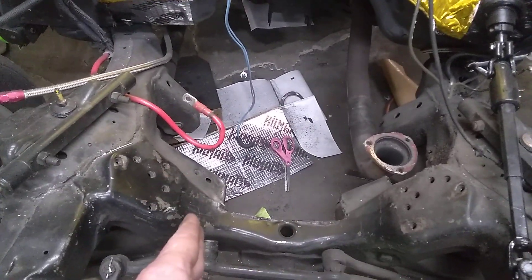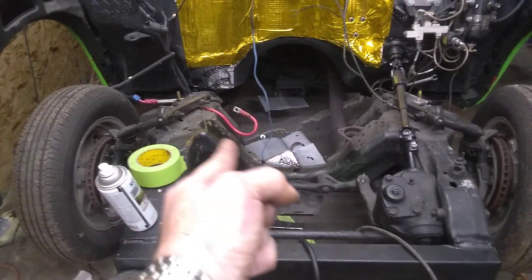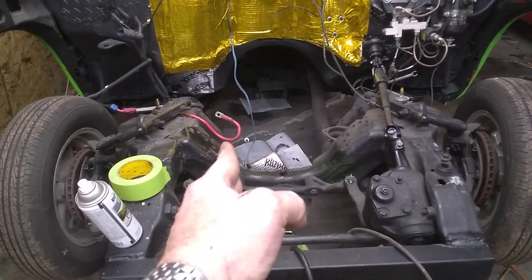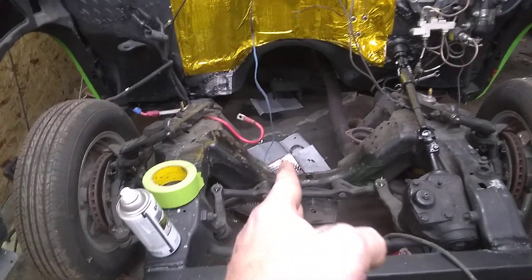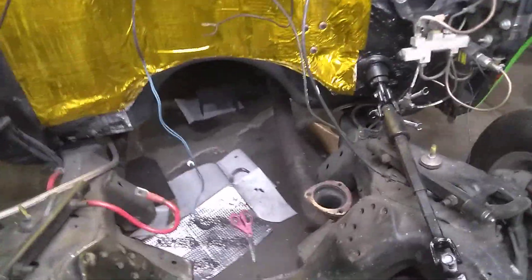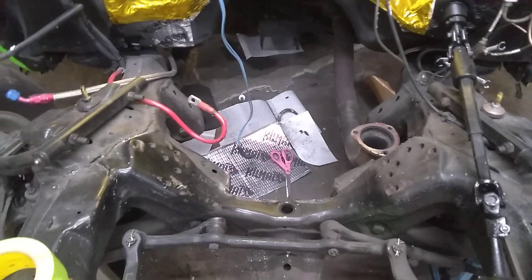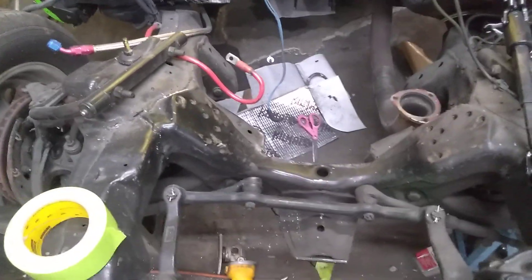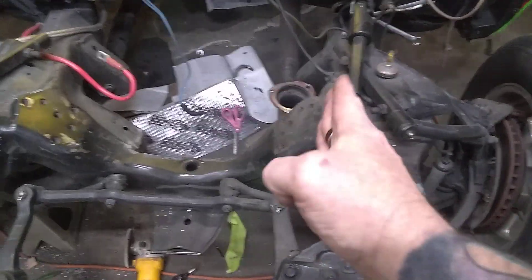Here's why: a V8 in a car — or a V6 — sets to the passenger side. That is done to give you the additional clearance needed for the steering on the driver's side. If you stand back and look at where that motor mount pad is at on either side, it's not hard to see that the entire thing is set over to the passenger side. If you put a straight edge up each frame rail and measure the center line of your air cleaner stud to each one, you'll notice the engine is set closer to the passenger side — again, to clear the steering.